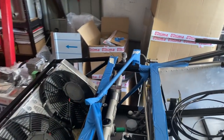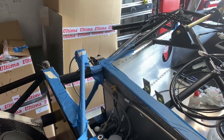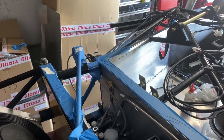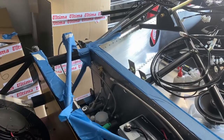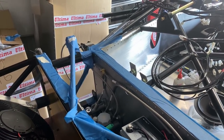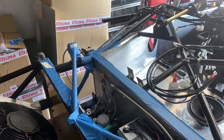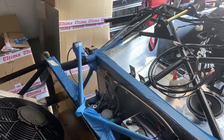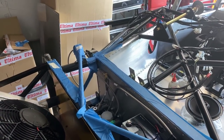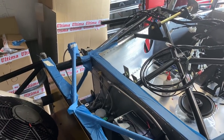The other thing that can be useful to install right now would be some fittings like this. Sort of like the brake light switch, it enables you to put in a pressure and temperature sensor that you can run back to your ECU for data logging. Like I say, if you are having braking problems, having a pressure sensor on the front and back brake circuit can tell you a lot, so you can work out what's going on, potentially whether you have a brake fault, or even a particularly faulty brake caliper, or a number of other things. So that's something really worthwhile having.